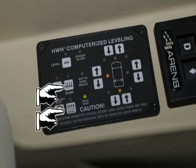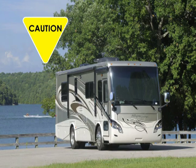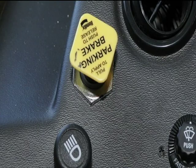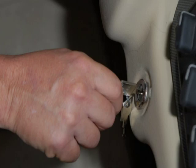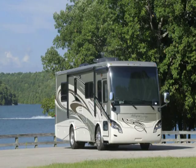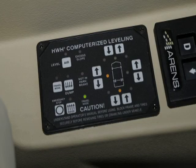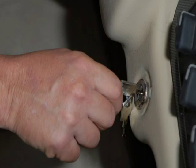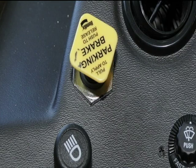These are the dump and raise functions. The vehicle may drop, raise, or move forward or backward without warning, causing injury or death. The raise and dump buttons can be used at any time the network is active. The park brake does not have to be on if the ignition is in the on position and the park brake is off. The raise or dump buttons will latch in. The vehicle will raise or lower completely and stay in that position. The vehicle cannot return to ride height until the travel mode button or the cancel button is pushed. Leave the engine running if the raise function is to be used. The park brake does not have to be set to use the dump or raise buttons.